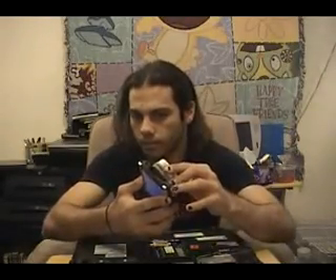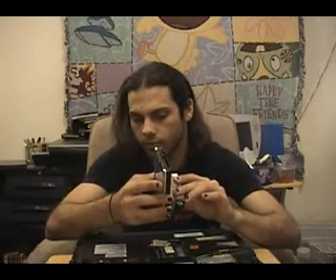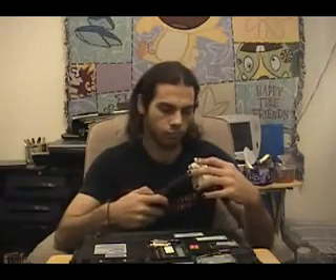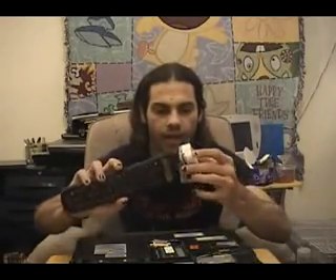Here's my pocket PC — let's see what it sounds like. Those are just some of the basic sounds of some of the simple chips inside. With a little bit of experience, you can actually go and diagnose your electronics and figure out what is or is not wrong. Here's the remote control in my house — you'd think it's a remote control and it doesn't do anything with radio, but you're wrong. It does emanate electromagnetic frequencies because it's an electronic circuit — it's got chips, it's got power. It's very faint; I'll turn the audio amp up a bit. Here's the actual activity LED.